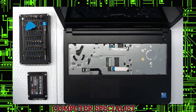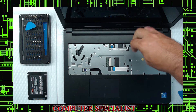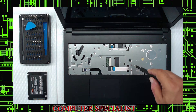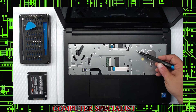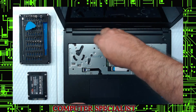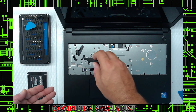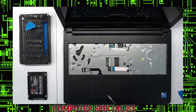Now we're on the top. Use a magnet — I use an iFixit magnet — for what I call the top screws. You're going to have one, two, three, four, five screws. These are all the same size. For people new to this, they're labeled 2.5 L5 — that's just the length dimensions. On this model they're all the same, so you don't really have to pay attention to where they came from. Pull them all out and set them to the side.